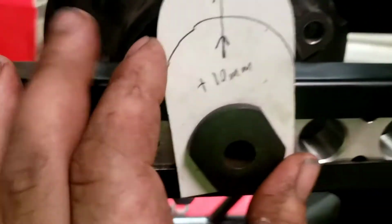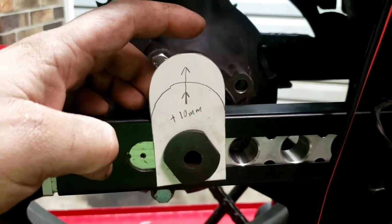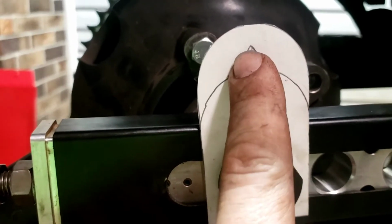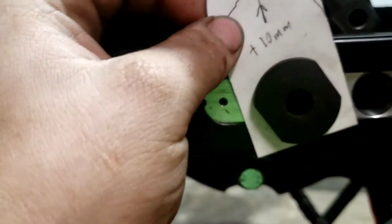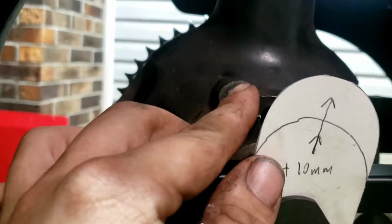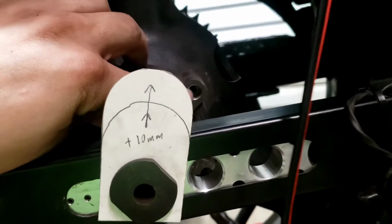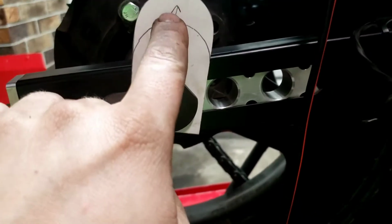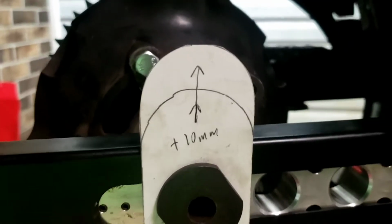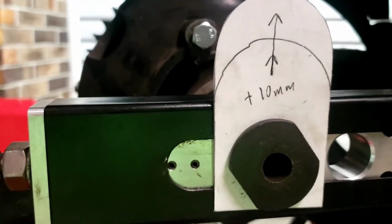We did start designing our bracket. It will read off of these bolts back here. I do need to make it 10 millimeters longer. So about there. And then we'll go ahead and drill a hole that lines up as spot on as I can get, because it has to be spot on since it follows. What I'll probably do is, believe it or not, stick a pen in this, slide it over, stick a pen in it, and just whoosh. That way I've got a crescent in the tire's pattern, and we'll find the center line, and that'll be our hole. We'll drill probably a 12.5 millimeter hole, big enough for us to weld an M12 nut to the back side of it. And that M12 by 1.25 should thread in our sensor, which is on the way.